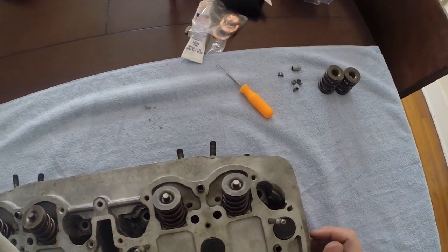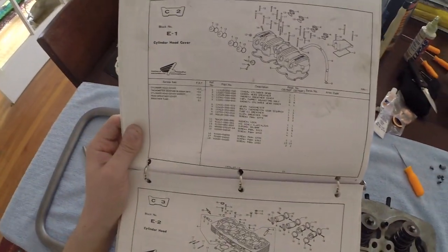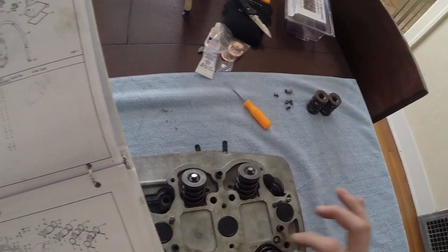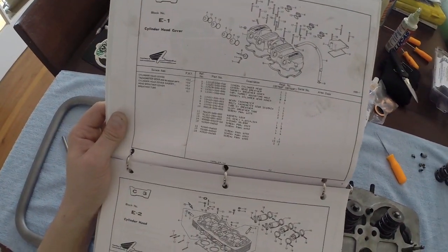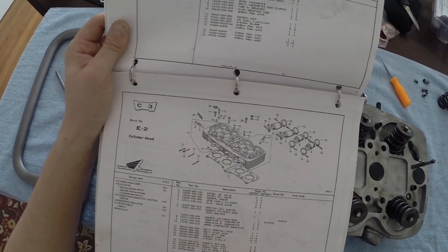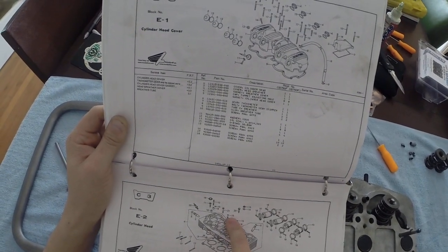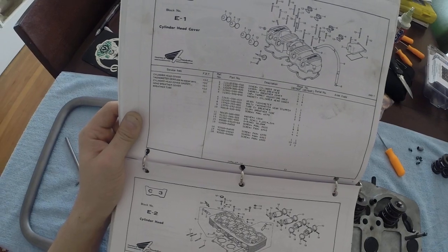So I think that should be okay, and all the dowels look the same. There would be an O-ring cut out if a dowel had to go there. I think it actually goes right there where I've got it. And I think that's it. So we've got number 19, which are the 6 8-pin dowels, 8x14mm. We've got the orifice, we've got all 4 O-rings, so we should be fine.